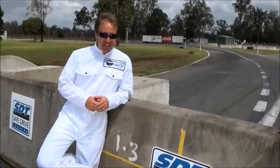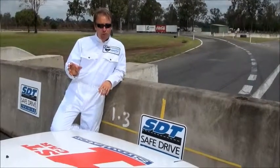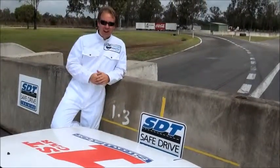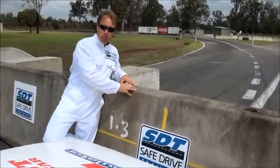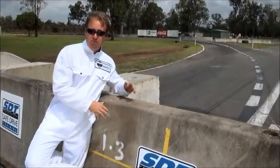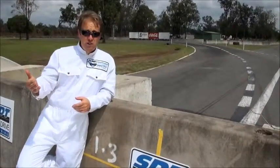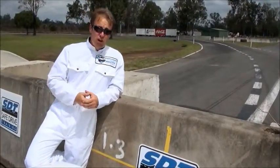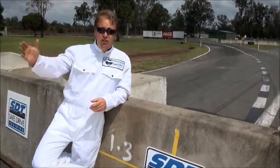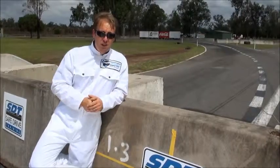T-minus 10 minutes from impact. This is where the physics is going to get really interesting. We have our vehicle, it's 1,140 kilograms, going to be coming down here at 80 kilometres an hour. It's going to hit this concrete wall, which is 3 tonnes, this block. Then there's reinforcing blocks behind. Now we picked 80 kilometres an hour. This could be the speed of impact where a driver falls asleep, inattention, runs off the road, or travelling at a much higher speed and the driver dissipates speed, brakes, and impacts the object at 80 kilometres an hour.